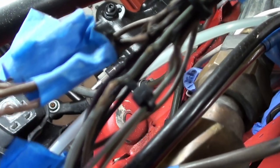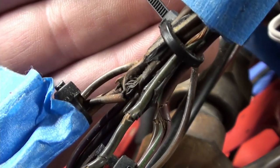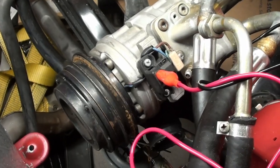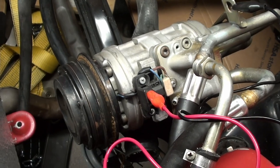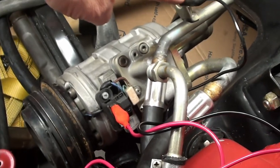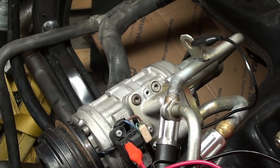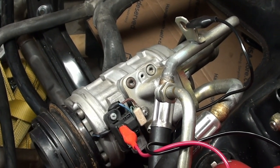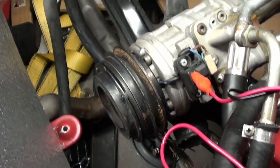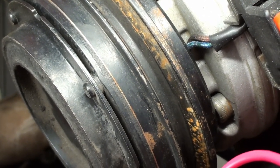This is part of that wiring, and you can see there are bare wires and all that mess in there — yeah, so this is probably one of the reasons why it didn't work. What I want to do is make sure that clutch functions, and that's the reason why I've got the positive hooked up to the power supply, and over here I've got my negative just hooked up to ground. So I'm going to go ahead and turn on my power supply and increase it and we'll see if this clutch works.